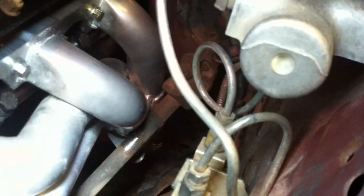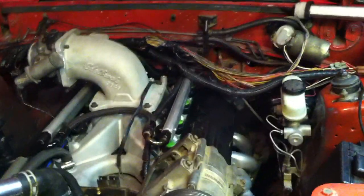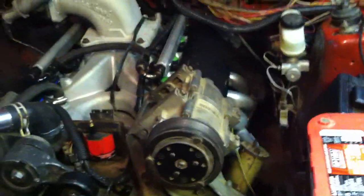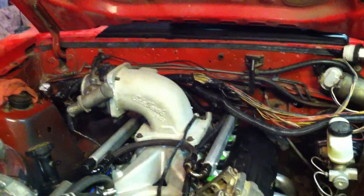With this light you can see where my header has been rubbing on my steering shaft — there are going to be some fitment issues. But if you use the regular engine mounts from a 302, the oil pan sits up where it should be, the 351 swap headers don't rub, and you don't have to space your k-member down — but you've got to use a cowl hood.